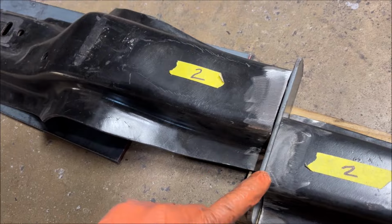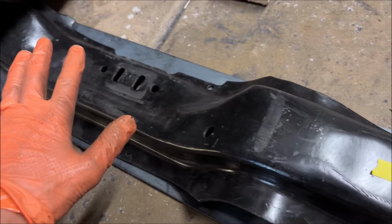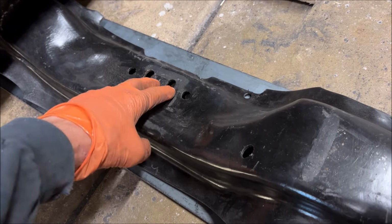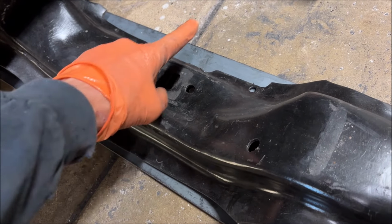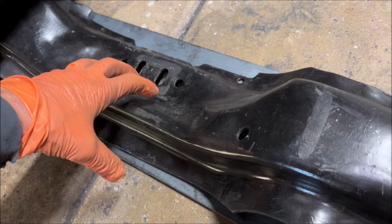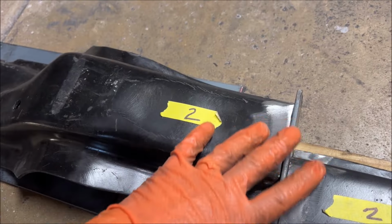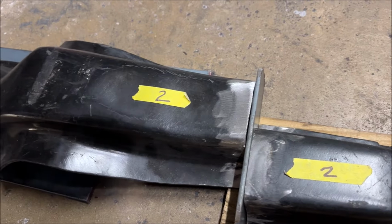And I only need a 2-inch offset because I'm going to have a 2-piece cross member, I can now run it instead of this hump back. What this does is this moves the cross member further forward. The front of the car is this way. So what that means is I don't have to have as much offset.